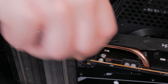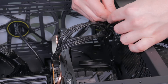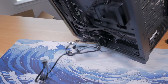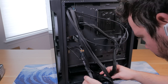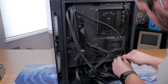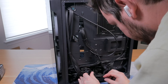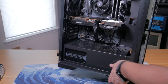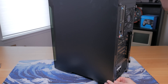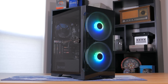With everything installed, we just have to neaten everything up. I recommend using a zip tie from the screw bag to neaten up the PCIe power cable, then cut off the end of the zip tie with scissors. Put the PC back onto its feet. To cable manage, pull all the excess cable length to the back of the case and use the included zip ties to secure the cable runs, making everything as flat as you can. You can also push excess cables into the power supply basement. Before putting on the panels, make sure the main chamber is looking good, then re-secure the back panel with the two thumb screws and put on the side glass.